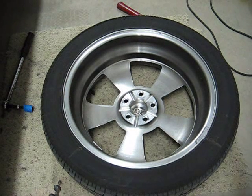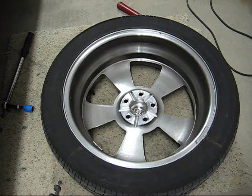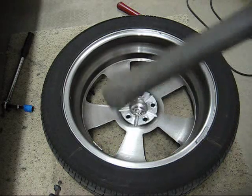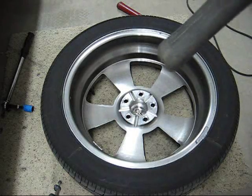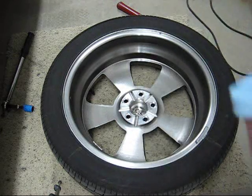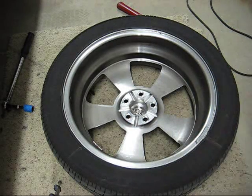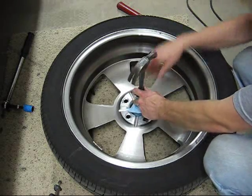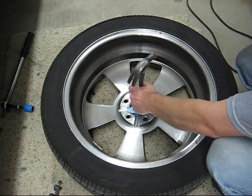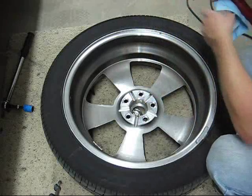We've got our wheel off the Challenger. We're going to go ahead and get out the factory center cap. What I'm doing — they recommend a wooden dowel, but unfortunately not many people have wooden dowels sitting around. I've got a hammer with a pretty heavily padded handle. I'm just going to wrap a blue cloth around that. We'll come in, place it square in the center of the cap, pick up another hammer, and just gently tap — we'll feel it pop out.